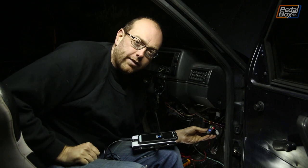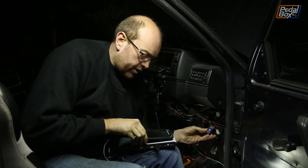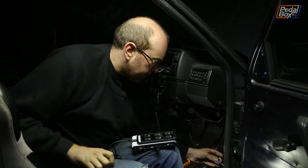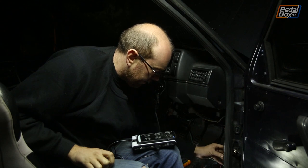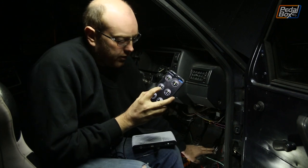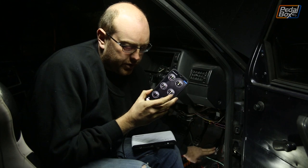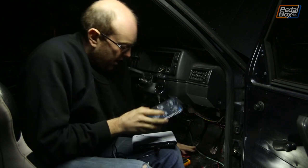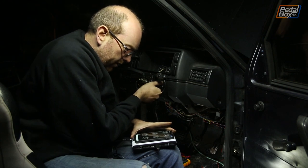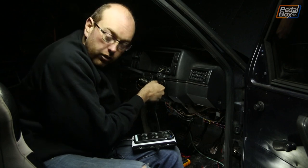All being well we should not have any errors, but you never know. There are no fault codes stored in the ECU, which is excellent. If we go to real-time information you can see on this dial it is showing my throttle actuation as I push through, so we are getting something. Now we can turn it over and see whether we show any revs — and if we do or don't, we can tell whether or not the crank position sensor is doing anything.